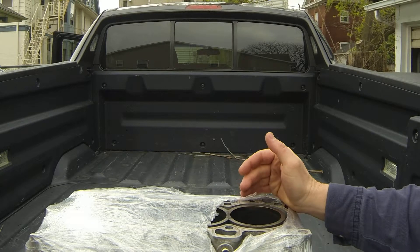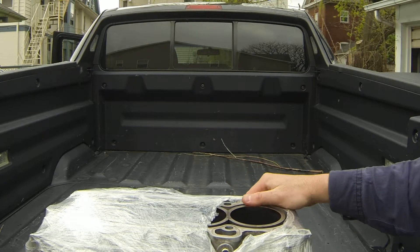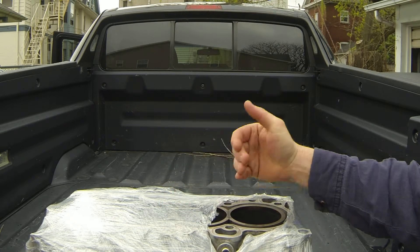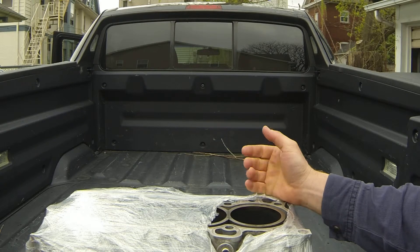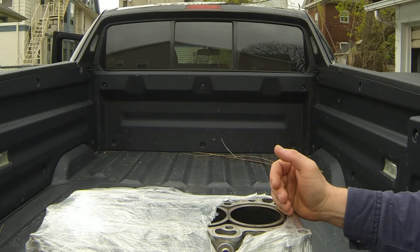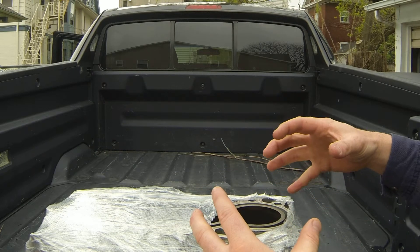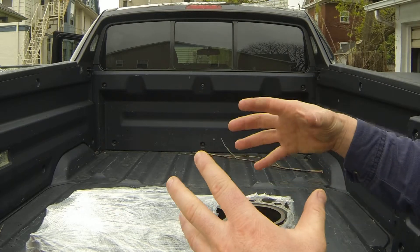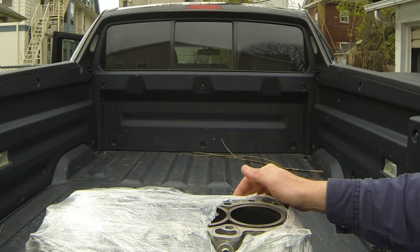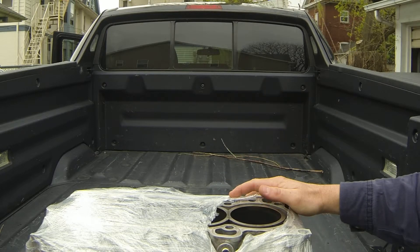So I'm thinking what happened — and with the assistance of a friend of mine, Gerard Paterka, Paterka Racing — we feel that the sleeves, when they expanded, went egg shaped a little bit because they were side loading each other. And when the sleeves were installed, they were installed green, meaning they weren't really heated up or annealed after they were bored. When you anneal something, it allows it to basically relax and move to wherever it's going to go. When you bore it, you're creating a lot of pressure on it, and it's going to hold that position until the metal relaxes after it heats up and cools down. So the metal was green, and from side loading, when it relaxed, it relaxed in a slightly egg-shaped position.